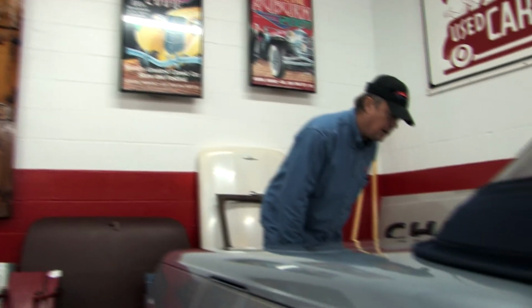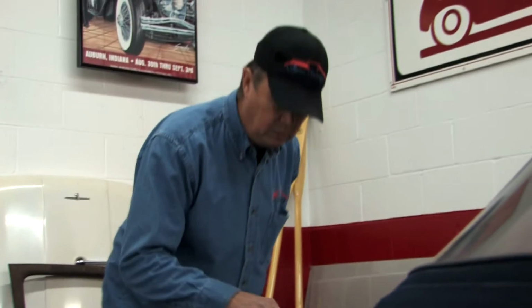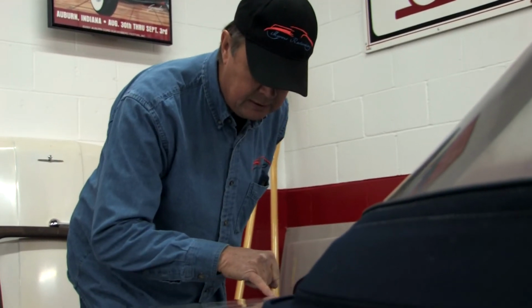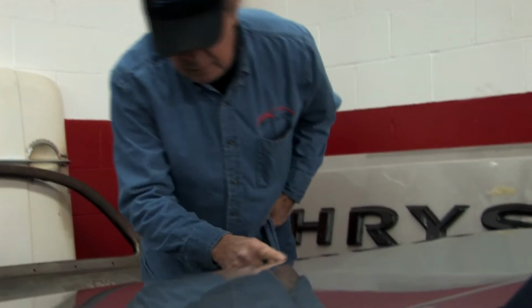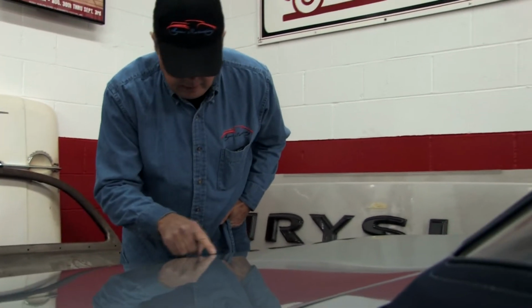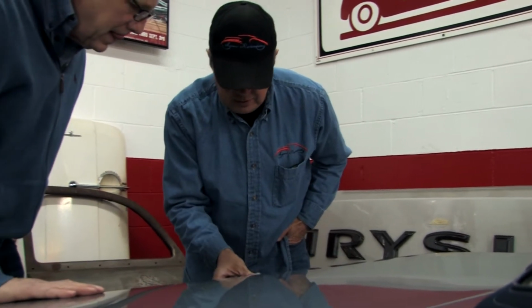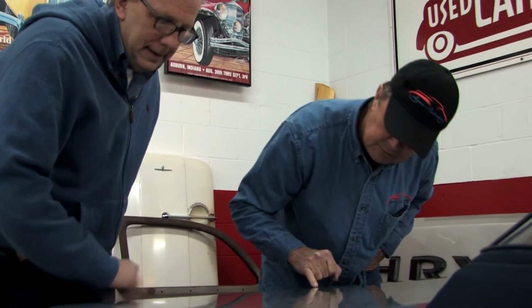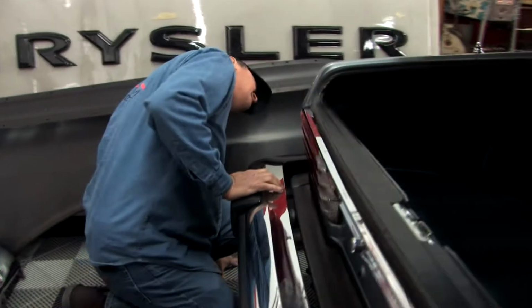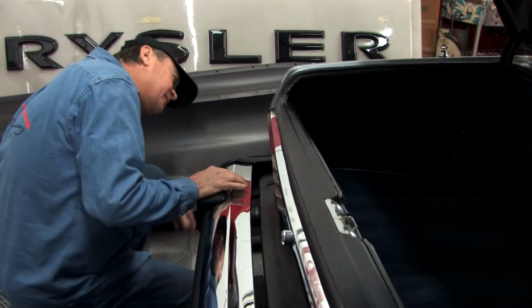It needs to be sanded off of there because anything you put on top of it is going to make it worse. It might hold up to a little buffing, but this little blend line might be where they've already gone through a little bit, or maybe it had another little dust in the paint right here. It looks like maybe they scratched it putting this on, and they had to put a second blend right here. Try to see how much body fill there might be in.